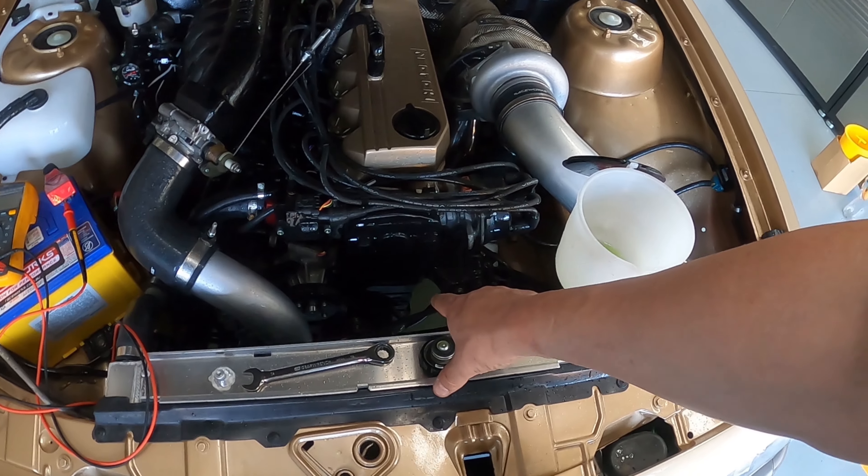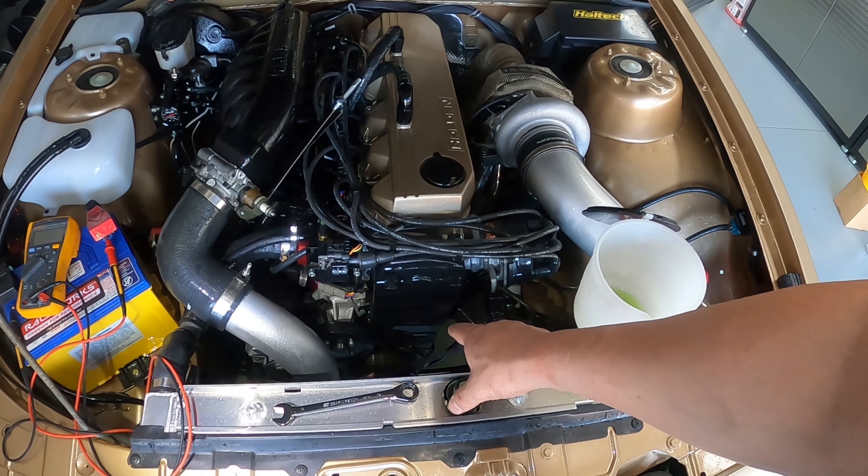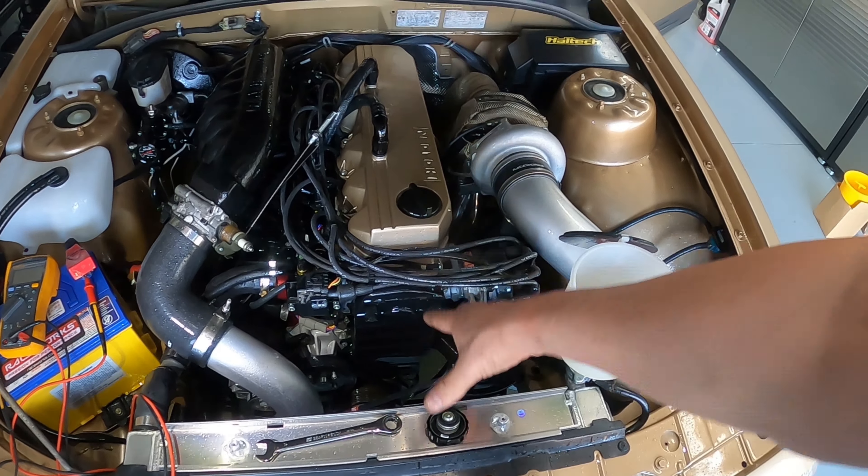There was one issue when it was running, and that was the exhaust manifold. Being that it is a cheaper high-mount one, it was a little bit warped. So what I've had to do to fix that is cut all of the exhaust flanges in between each of the runners. Right there in between the runners, you can see a split. I've done that to every single one so there are two bolts per runner, making them individual runners — and it's all clamped down perfect. So it's smooth, quiet, no exhaust leaks. Brand new gasket straight on there.